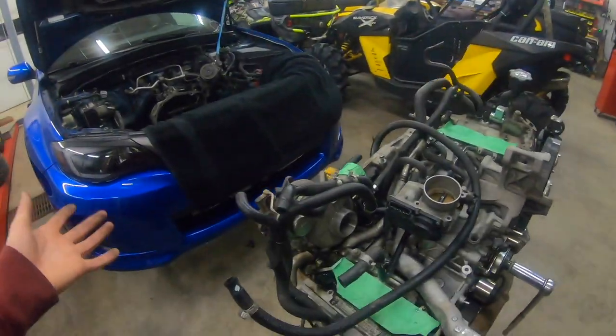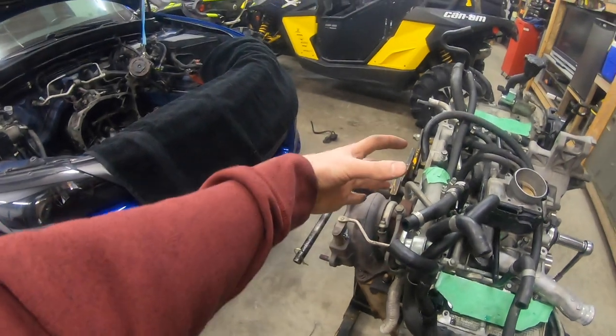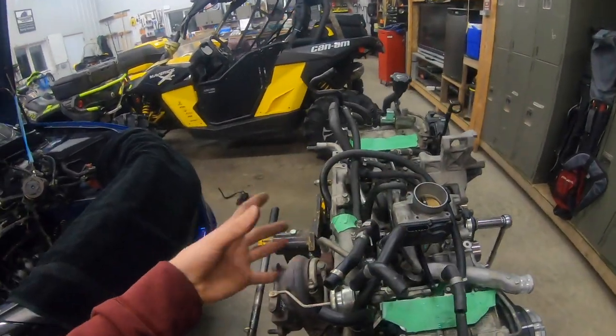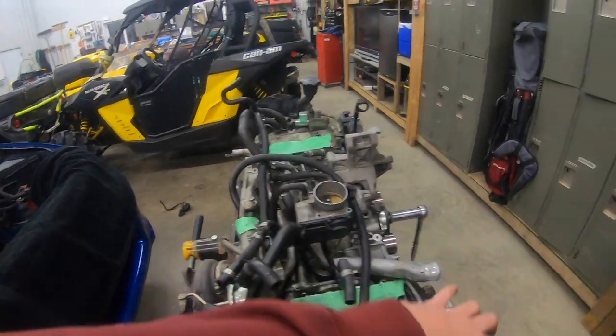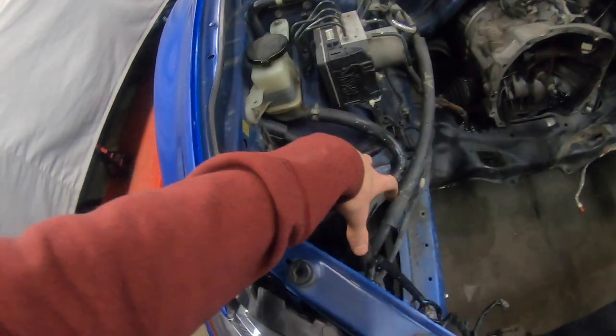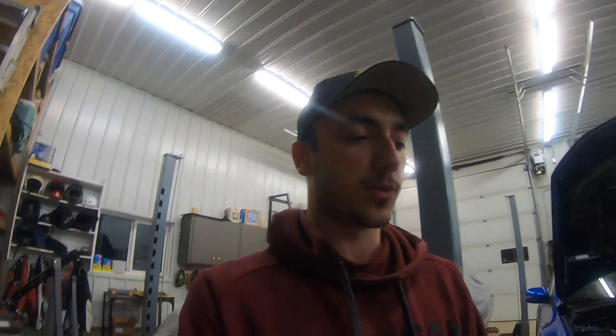For those of you that don't know, rotated turbo gets rid of this stock turbo. The up pipe's a little bit longer, sits higher, and your turbo sits rotated so that the charge pipe, or turbo inlet, I guess you want to call it, comes over the intake manifold into your fender, and my filter will probably be sitting around somewhere there. The ETS rotated turbo kit will come with a V-band up pipe, a V-band down pipe. All the connections are V-band, which is super convenient. It's a lot better and seals a lot better than a three bolt kit or whatever.